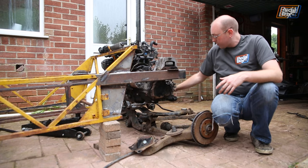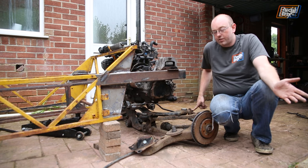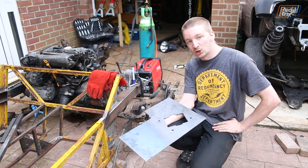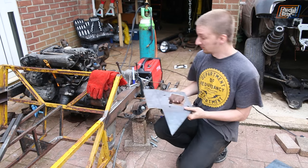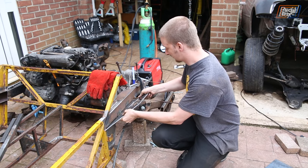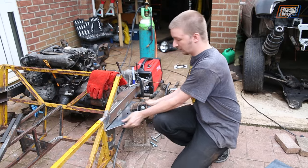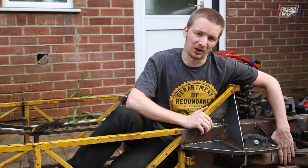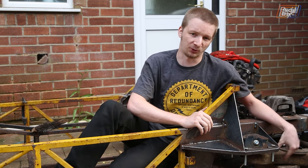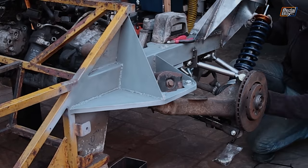Next up we needed to sort out suspension. The TT has some convenient, if extremely heavy, cast trailing arms for the rear that use the same size hubs and drive shafts as the front. We just needed to add some steel for the forward mounts to connect onto. But everything inboard intersects with both the block and the sump where the differential subframe would normally connect, meaning every single hookup needs redesigning. And neither of us are engineers, much less automotive engineers.